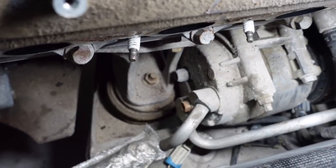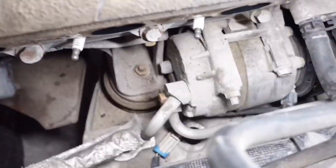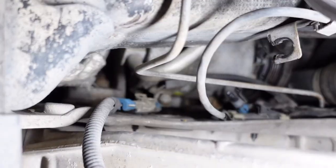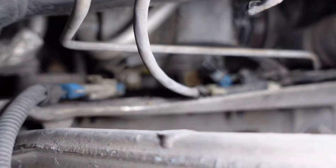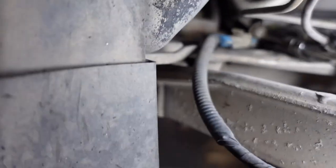Let's go ahead and remove the two top bolts - we've got one here and one there. There are two more on the bottom that we can access through the wheel well. Take the wheel off and we'll take the bottom ones off first. I got the passenger side wheel off and turned the wheel all the way to the driver's side to get some access back here. Right between the frame rail and the lower subframe you can see the bolts right there. We've got plenty of room between the wheel well to just stick a wrench or a socket with a six-inch extension on those 15mm bolts.